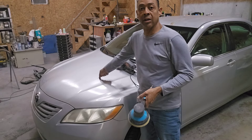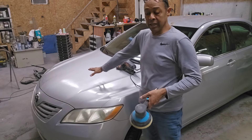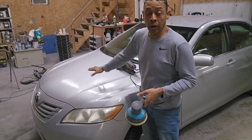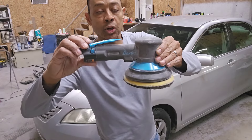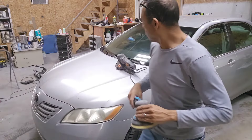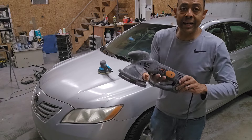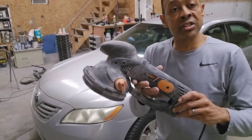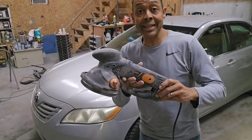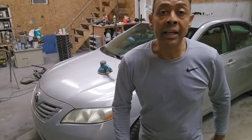I'm trying to get down to as close to bare metal as I can on this hood, because all of this crap paint has to come off. It was a repaint that was done wrong — now it's all chipped up and there's rust. I need to take as much of that material off as I can. I'll run the Baxter geared DA sander first, then the new Max XT, and see how well it can take down this hood. I'm gonna go put on my suit and then we'll get into the action.